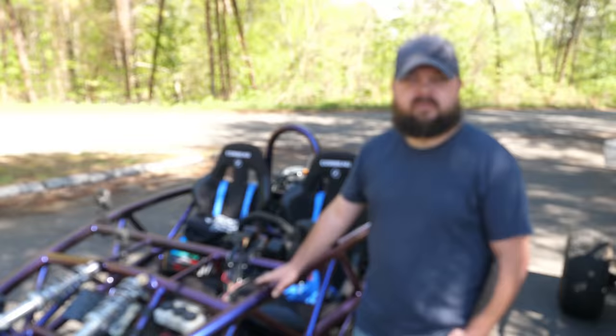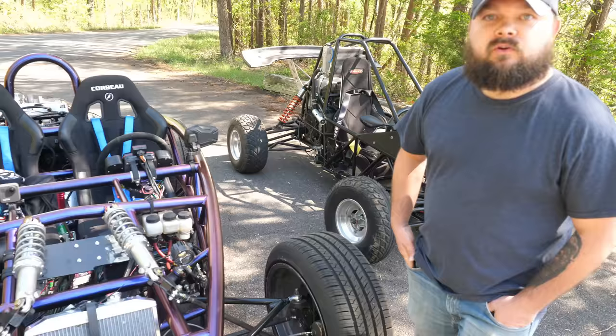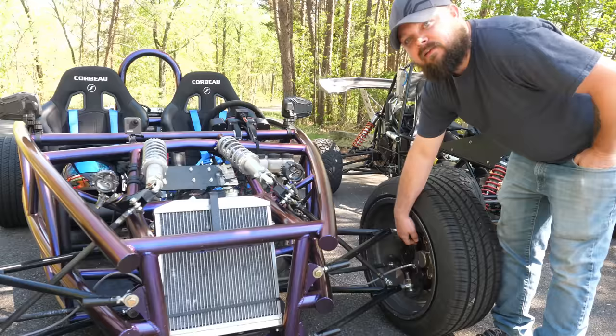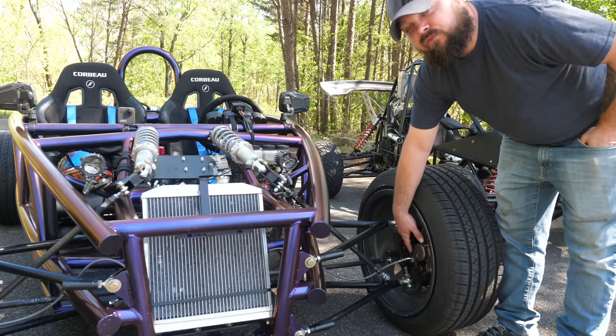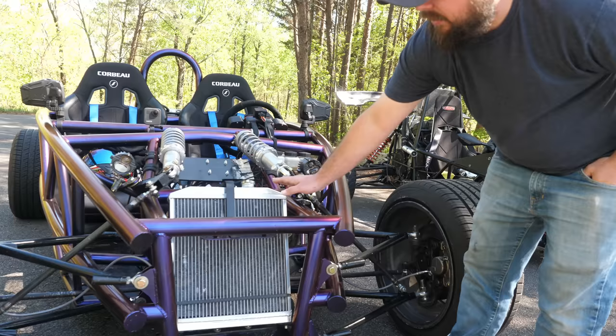And it's a handful. It's a lot of fun, and it took about a year and a half to build it from the ground up. So since it's an all custom build, we had to figure out what to do. We ended up going with Mazda Miata spindles, and we welded grade 8 bolts to them to be able to use the heim joints we needed. And so this is an entire Mazda Miata front end, and we went with your basic pushrod style suspension like your real Ariel Atom, double adjustable coilovers, and then the radiator is a basic Honda Civic radiator.